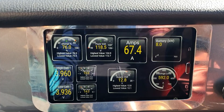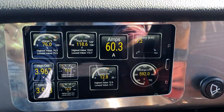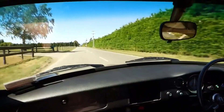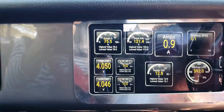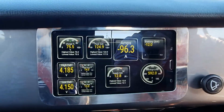At the same time as all this was going on we decided to convert the car to right-hand drive. This was a pretty straightforward exercise from the steering column and pedal cluster points of view, but the dash took some serious chopping and welding. Fortunately I discovered a guy in Australia making left-hand side glove box apertures and lids and that saved a huge amount of work.